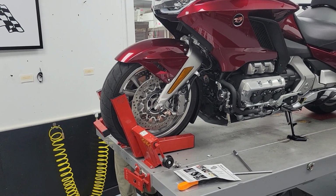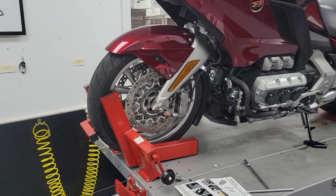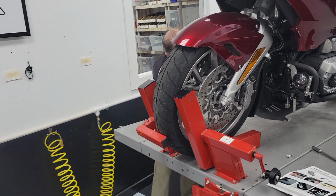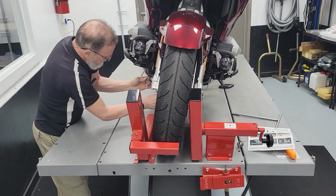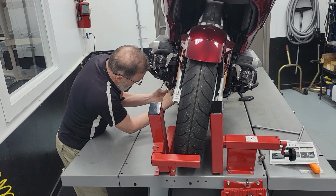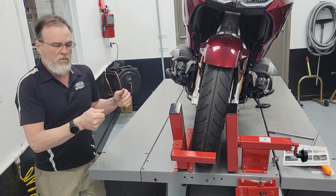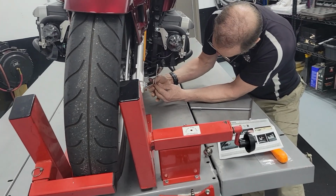So by doing this, we'll gain about 3/16 of an inch of that half. It's not a lot, so it's still going to be off, but I'll show you. All I'm doing is replacing this to the inside. Now the back bolt, the plate, you slide it up and you just put a nut over the stud that you installed on that cross member on the engine. That is slotted, so you get some fore and aft motion that you can slide the plate to adjust it if you desire. So here we are back to our problem.